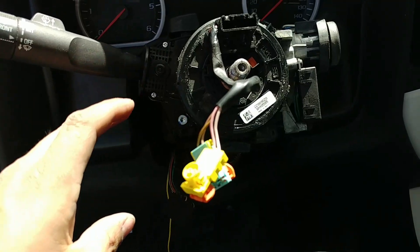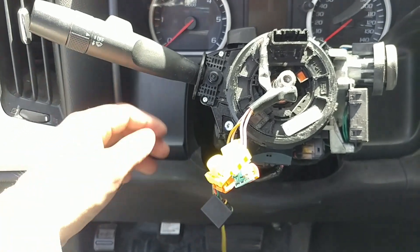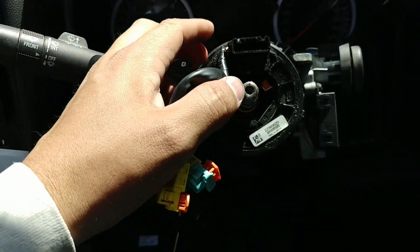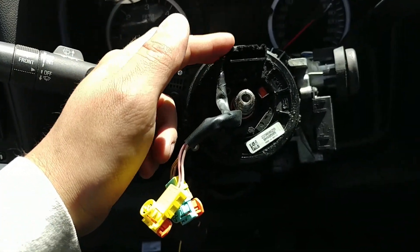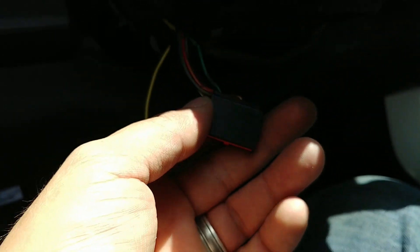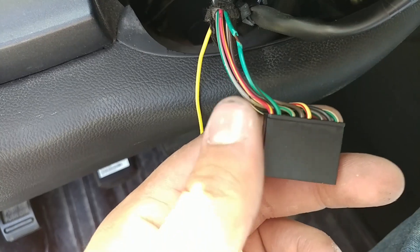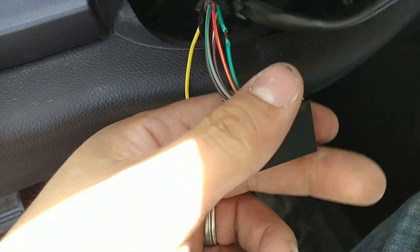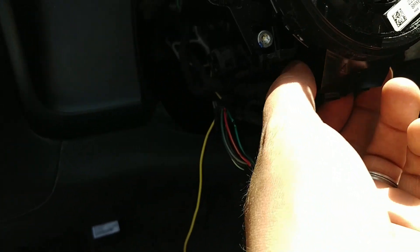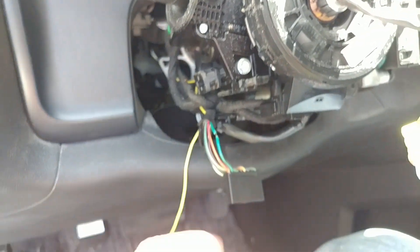I got everything off but I'm a little confused about where to plug in the control wire coming from the gauge cluster. I thought it was going to be up here, but when you turn the wheel the wire might get snapped. I think it's going down to the connector for the clock spring, which I already took off. The wire colors aren't really matching up, so I'm going to try hooking into the green one which is pin number 2 — that's what it says on the diagram. There's another small four-wire harness here but I doubt it's that one, so I'm going to tap into the green wire.